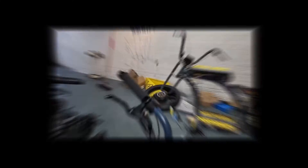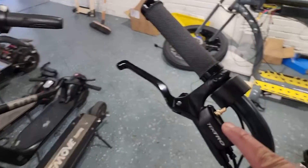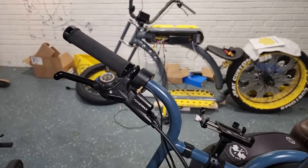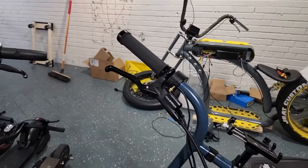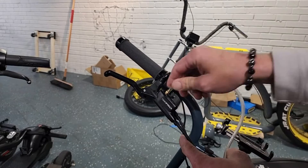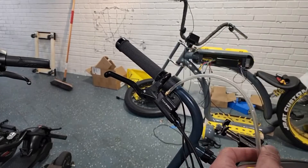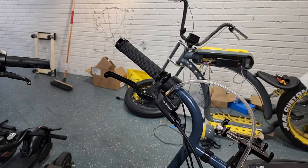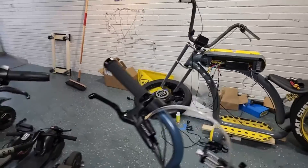You want to make sure to get your mineral-based hydraulic brake fluid. I recommend getting it from Shimano — they have the best fluid in my opinion. In the brake handle I've already put my brass fitting in. To the top of the caliper I'm going to attach my overflow bottle, and go ahead and hang that on the customer's phone holder.